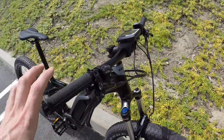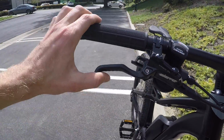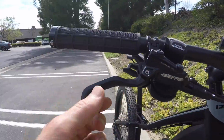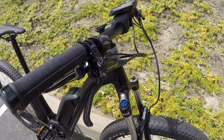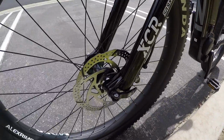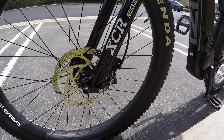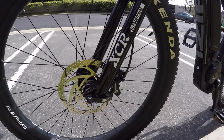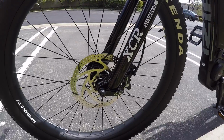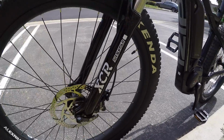And then these brakes, these are another really great highlight. This is a Slate T4 with 2-finger textured levers, adjustable reach. They're hydraulic 180 millimeter discs. So check that out. Really great, front and rear. This is a company I wasn't as familiar with, but apparently they do a lot of cyclocross stuff. They seem to be working really well. I was testing them on the Sumo from IZIP earlier, and they're 4-piston front and rear.